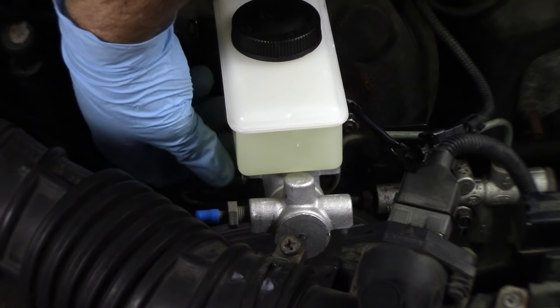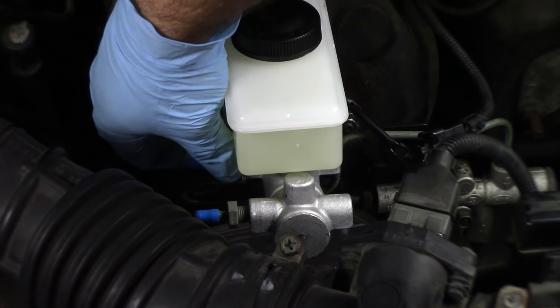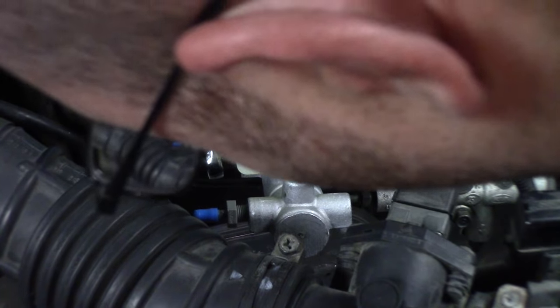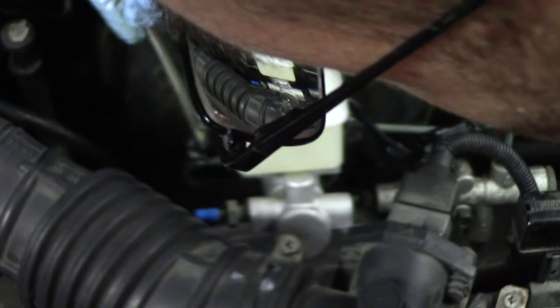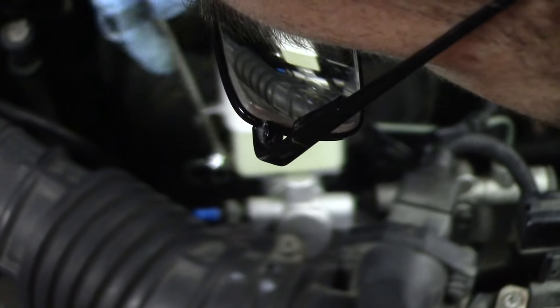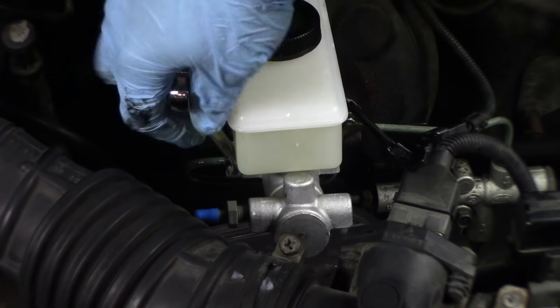So one at a time, I'm gonna remove the plug that's there, put the brake line in there. If it's very hard to turn these, you know you've stripped the threads, so be sure that when you're starting them, you can just hand thread the nut in there, because you do not want to strip the nuts or the threads in any way. Make sure we're good and tight.